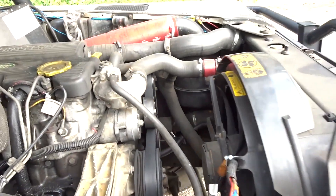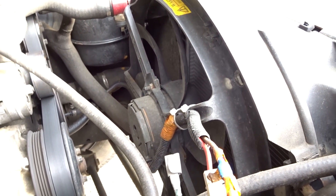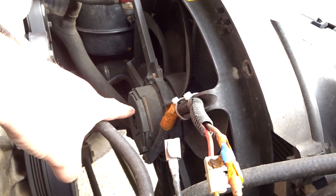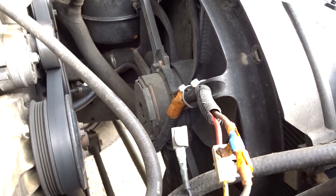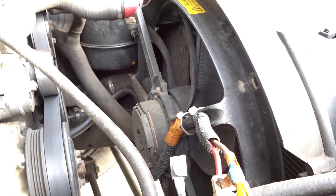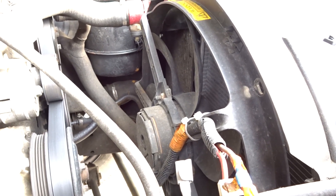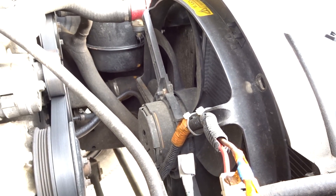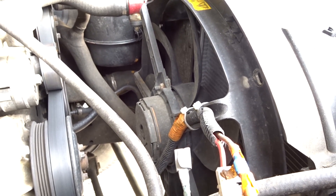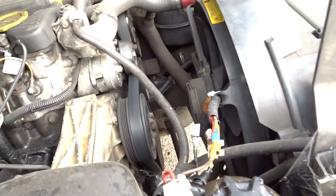The viscous fan has been taken off and an electric fan has been fitted. For some unknown reason, this metal shroud is live — not earth — for some bizarre reason, so you might want to look at that. I think they wanted to swap the way the motor ran from pulling air to pushing air, so they wired it the other way around, and now the casing of the motor is live. So if you're doing spannering work, disconnect the battery first or disconnect the fan connections, just in case you accidentally hit the back of the fan motor.